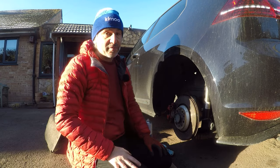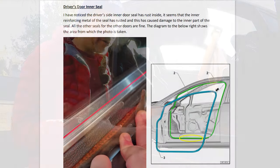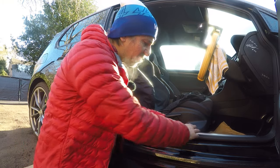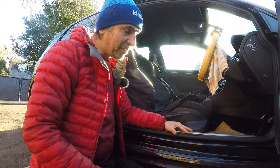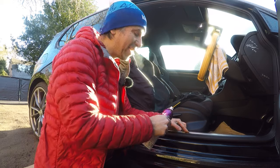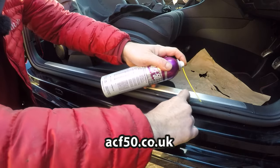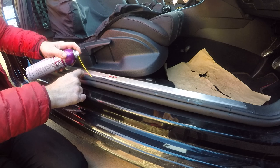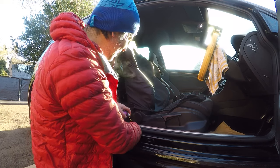The second area at the back is where the quarter panel meets the rear bumper — I've seen this on really nice low-mileage Mark 5s. It could be a bad chip that takes the paint and protection off and that's it gone. I've brushed out all the muck, used some multi-lube to clean it off as best as possible, and then just getting some Dynax UC in there. Also, one of the most intriguing photos showed corrosion in the door seal — on the dry side of the seal, which is really strange. This time we're using ACF-50, which is more runny and will get into all the crevices. Just peeling the seal back, using the nozzle to spray ACF-50 in between the seal and the plastic seal trim — because it's quite runny it'll get into all the areas it needs to.